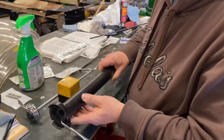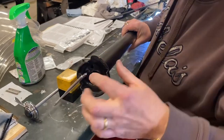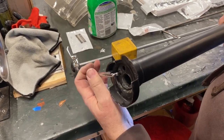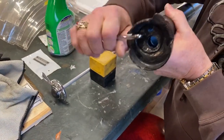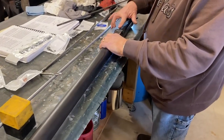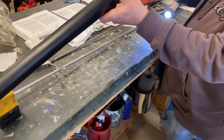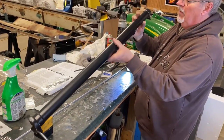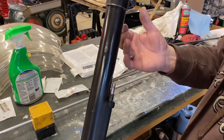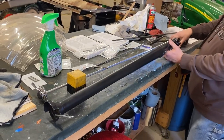Our steering shaft does not have a removable piece here. Some of them have a screw where this can come out and change that whole bushing, but this one's been pressed on. If it was removable, it's a little easier to play with the rods. We did get this rod in already — it needs to go in just a little bit further. A lot of guys do tricks where they solder on a piece of wire as a guide to get these through the holes. All we did is turn the tube and make that the lowest point, so the rod just dangled down. The pointy part of the rod was able to follow and hit the hole. I just used a flashlight and looked down through it to make sure we were at the lowest point and got the new rod in there.